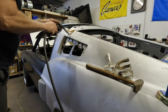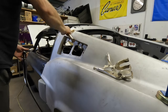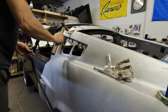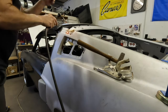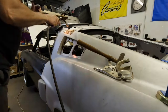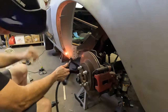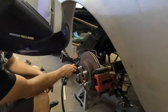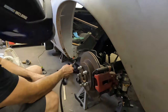Now that that's completed, moving up to the top part of the quarter panel where it meets the frame and the roof will overlap. This is the driver's side inner wheelhouse — I'm welding it to the outer rocker right now and then I'll be welding it to the inner rocker as well.